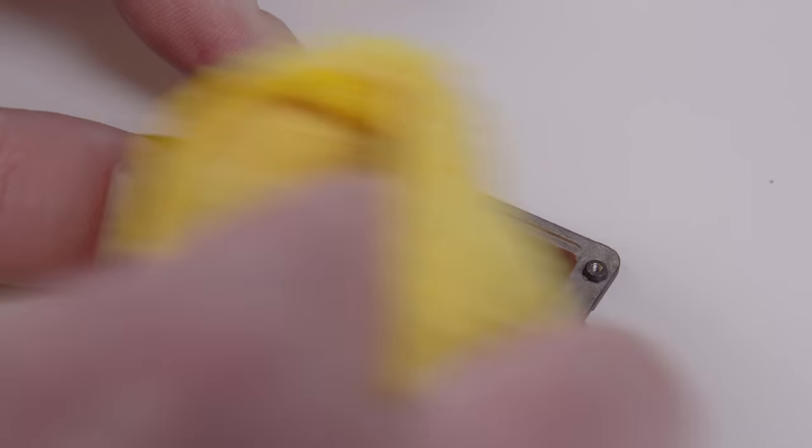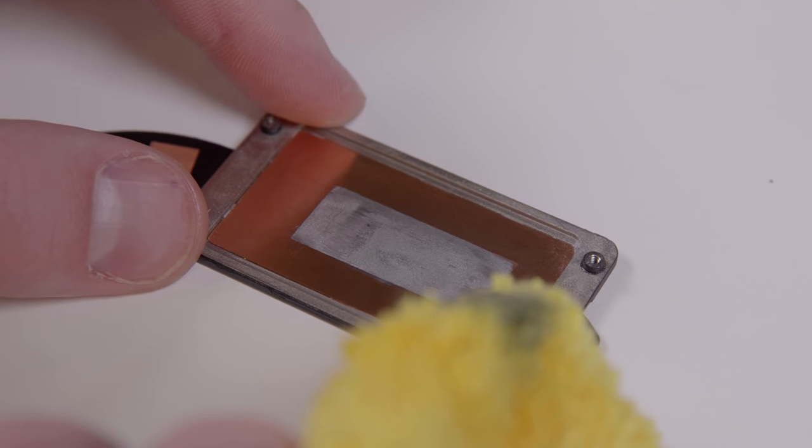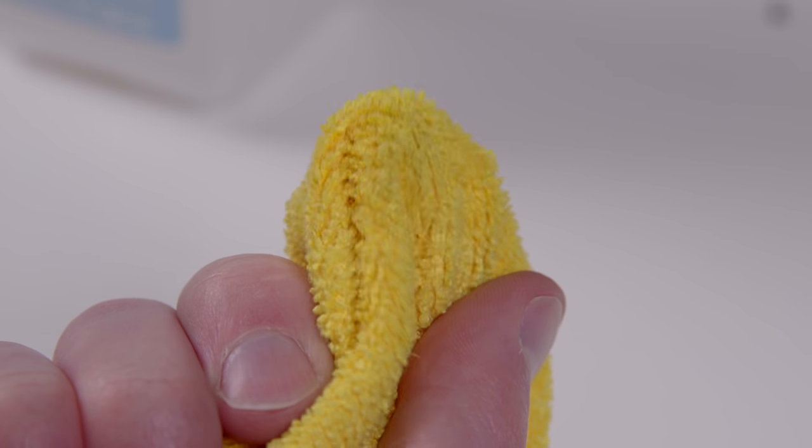It's not even slightly wet. In fact, it's basically 100% dry, and it's not until I rub the block with a rubbing-alcohol-dosed rag that I can pick any of the liquid metal up. Now, that would lead me to believe that maybe the cooler shim wasn't making contact with the CPU die, but that also seems pretty highly unlikely, given: a) the insane mounting pressure that Apple uses on its coolers, b) the excellent temperatures that I've been getting ever since install, and c) the fact that the die is not dried out.